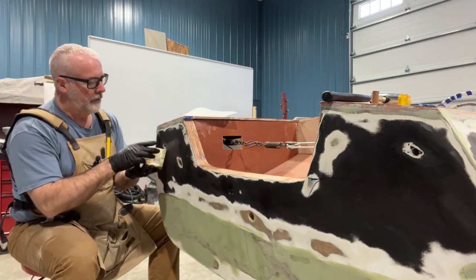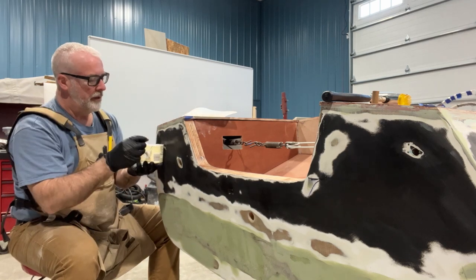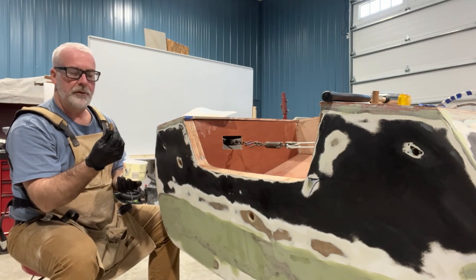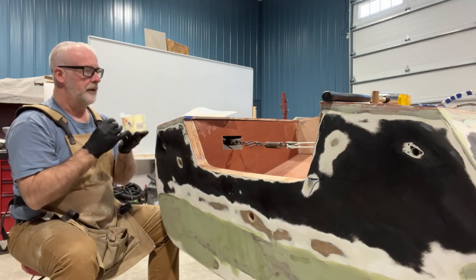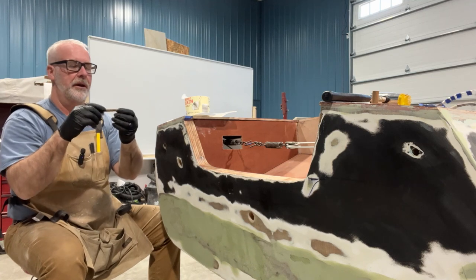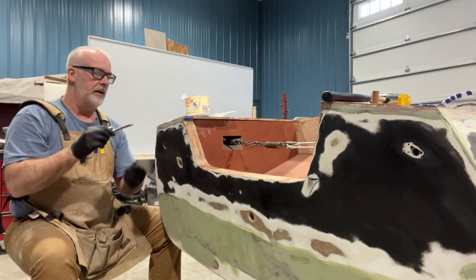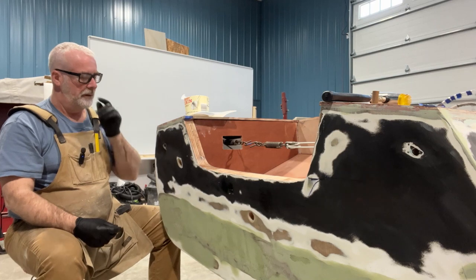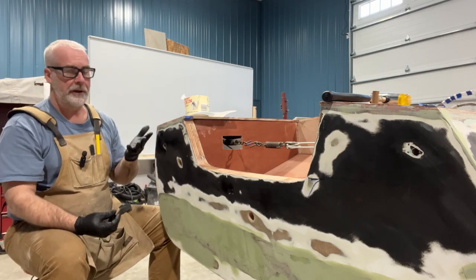For the larger ones I use a brush. For this area I'm going to use what they call bushings or sleeves. Here's the stern eye — I did this in the bow eye too. The stern eye will fit over that, and when I push it in there it'll be a tight fit, and there won't be any working going on in that wood and glass creating a void or breaking my really nice paint job.